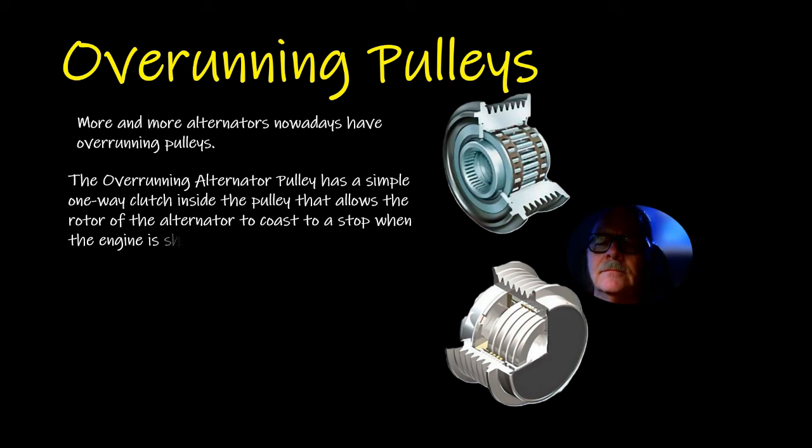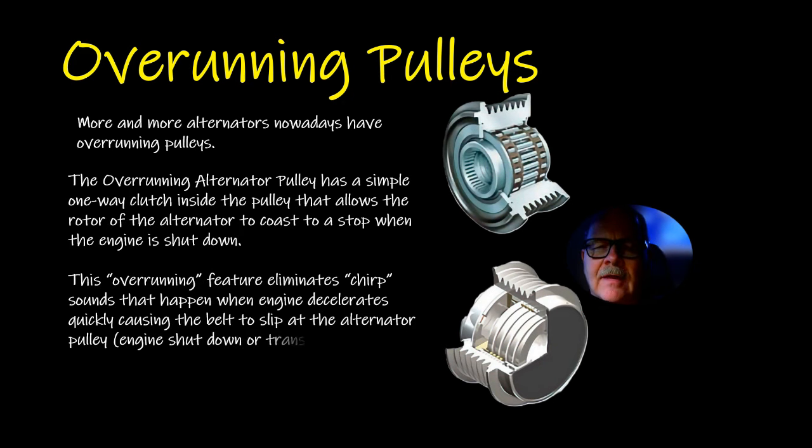All right. What I was getting at in that previous one was when you load the system and it pulls the voltage down, you should see the amperage jump way up to just about the max, because you're measuring it right there at the battery. So on that other one, the one I just showed you in the video, when we loaded it, the amperage stayed down low, and furthermore, we're hearing all that whining from the bad stator.